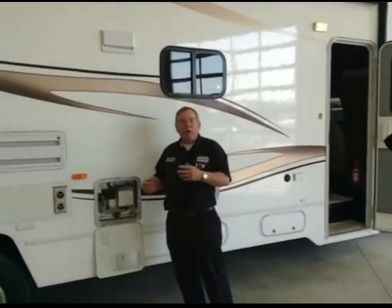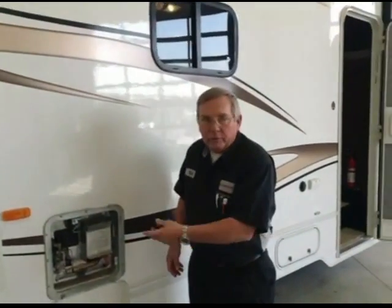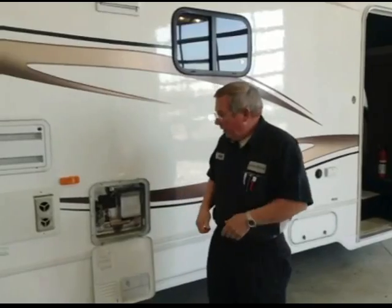Okay, now we've flushed out all of our sinks, the toilet, outside shower. We now have flushed out the water heater. Put the plug back in the water heater. Turn your water back on. Now you want to fill your water heater up, so you're going to go to your hot faucet and you're going to turn it on until you get a steady stream of water out. As long as you have turned your bypass on the back to where you're not bypassing your water heater. If you get water right off the bat and you don't get any air, then you haven't turned your bypass back on.